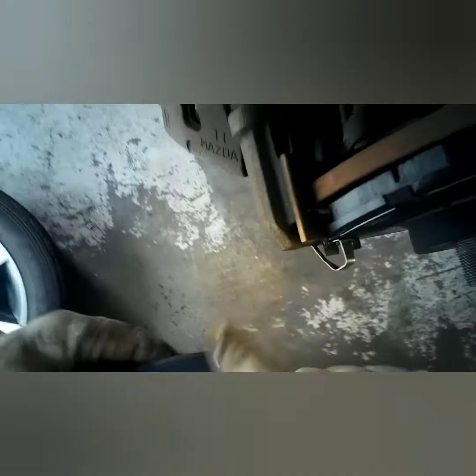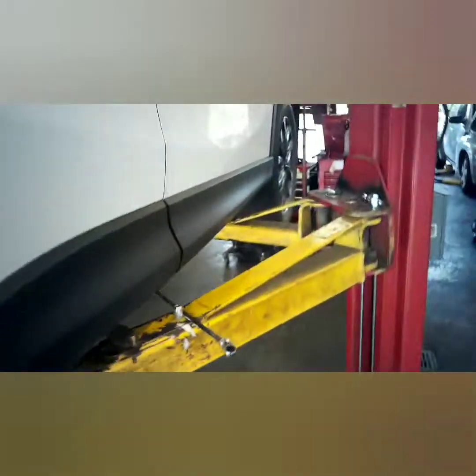Make sure that little spring is touching the caliper bracket, not inside the clip right there on the caliper bracket. That way it can do its job. If you didn't put this in maintenance mode, that will not push back. And don't keep trying because you can damage the caliper. Trust me, you don't want to mess this caliper up. It's an expensive caliper.